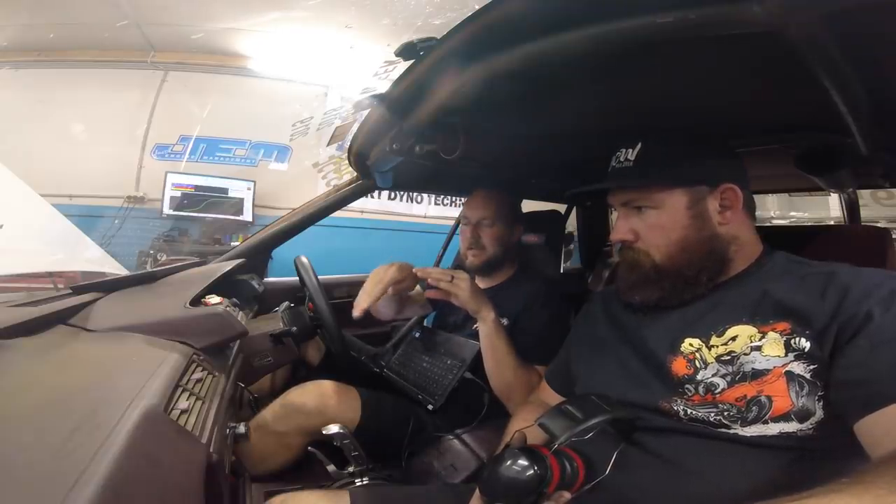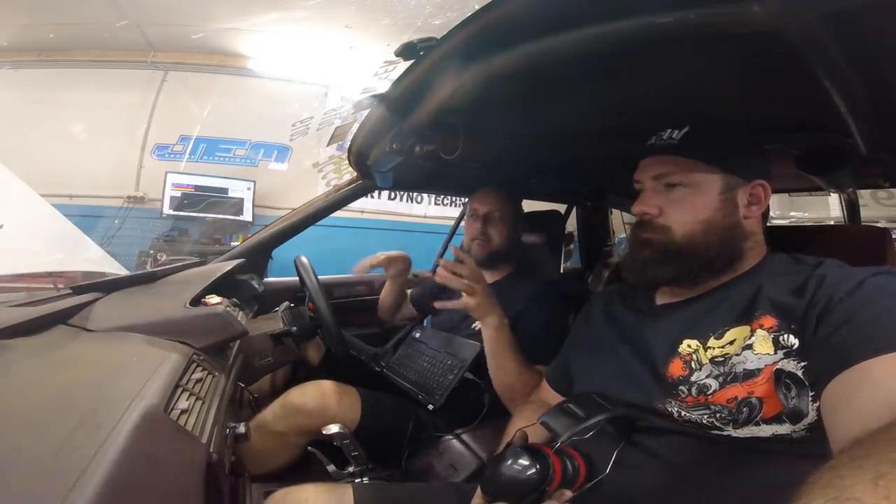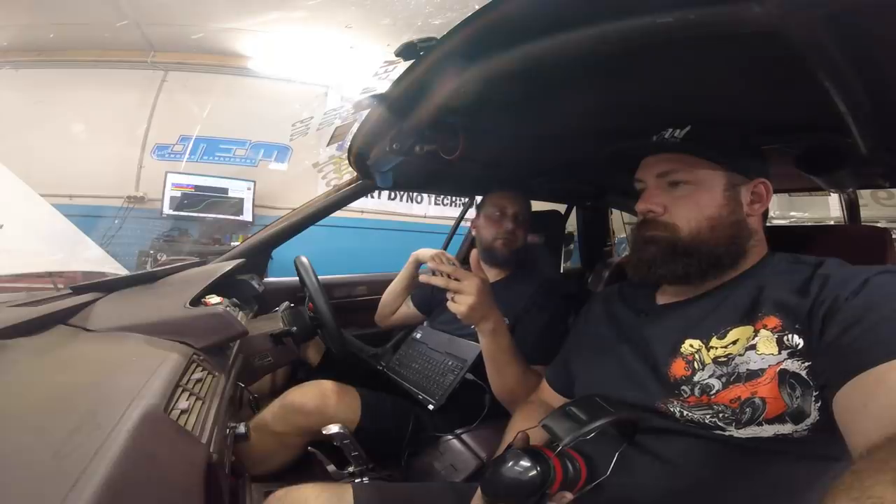We're holding air fuel ratio at the moment, but we're running out of fuel pressure, which means we're not stuffing enough into the fuel injector. So the pumps have run out, not the injectors. This problem could be a variety of things — voltage at the pumps, we've just lost a pump, the filter basket on the pump, a supply problem, low pressure supply to the pump, or we've kinked a fuel line somewhere and it's got a tiny little fuel supply to the whole thing. In any case, right now, if we take the return line off and put it into a Coke bottle and give it a run, by the end there will be nothing in it.